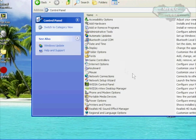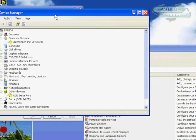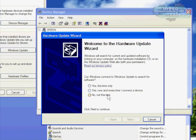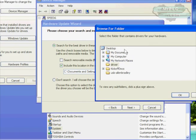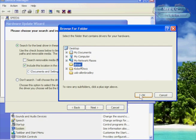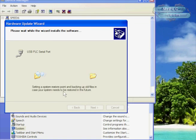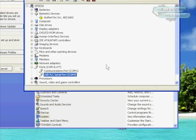So how do we fix that? Same process as earlier — right-click on it, Update Driver, and now we get the Update Wizard window again. We'll say No to this, click Advanced, Next, then browse to the folder that has the driver in it and click OK, Next. We get the hardware logo window — say Continue — and we'll go ahead and install the serial port portion again. That will finish, and now we have a USB serial port installed.